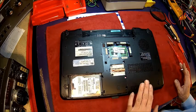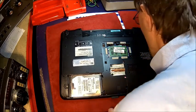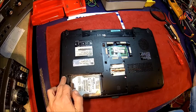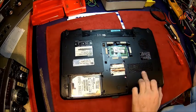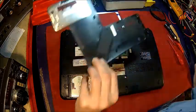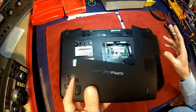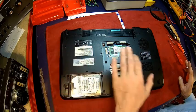While you're there, it's always a good idea to clean the fan as well because there is some debris inside. If you blow it out you can see a lot of debris and dirt coming out. All the screws on the C660 — and I think the C650 is the same — just remove all the screws marked F8. There is one down here so you need to take that cover off. It's pretty dusty inside. There's one screw here which retains this section, so just pry it off gently and it comes off, then you can get to that screw.